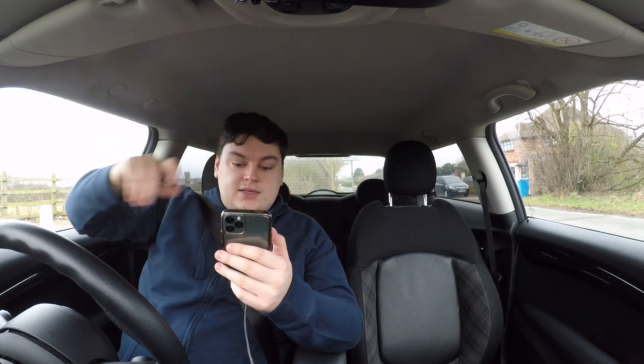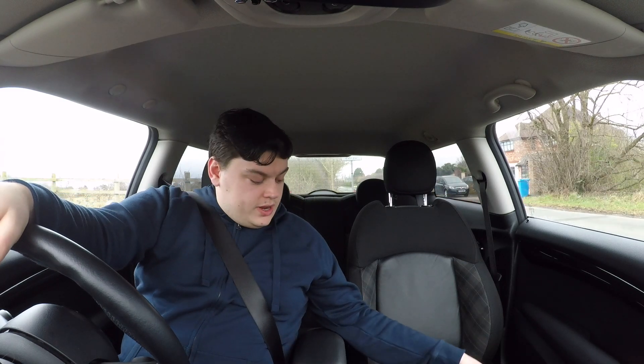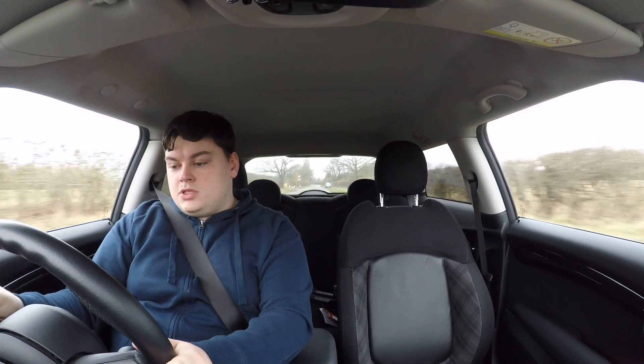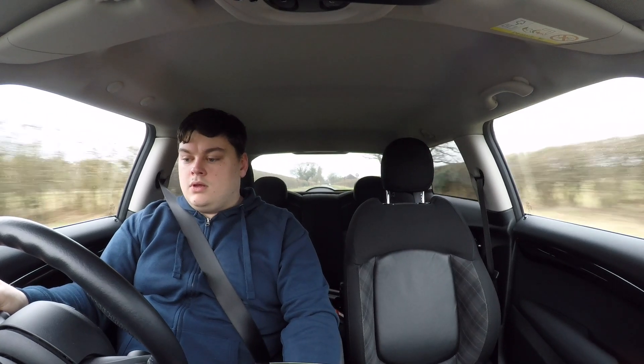Then coast the vehicle for a few miles to get the discs cool. Do not pull up and park the vehicle with brakes excessively hot — you must try to get the disc temperature down below 60 to 80 degrees Celsius. So, I'm on a straight road here, we're going to give it a go. Engine's nice and warm, brakes are warm since I've come here. I'm going to get up to 60 and brake.